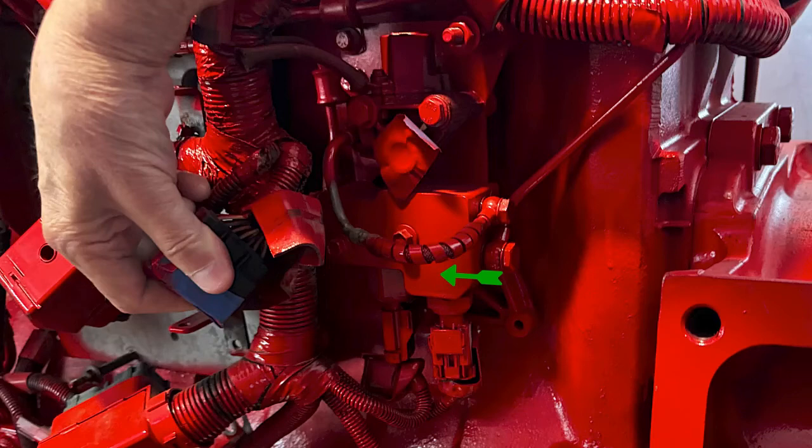Okay, we're going to go through this quick. Here is the fuel distribution housing. This is the fuel pressure sensor that tells the ECM the pressure inside of that fuel distribution housing for the after treatment. That's the on/off valve that allows fuel to come in from the fuel filter head housing into that block, and then once it's in the block it is sent to the injector behind the turbo.